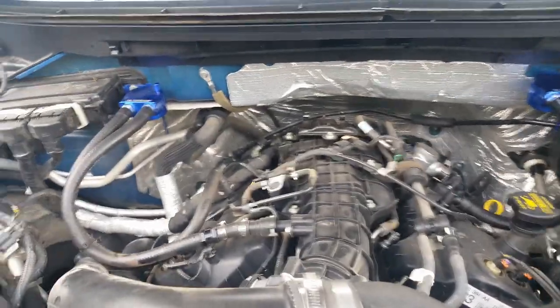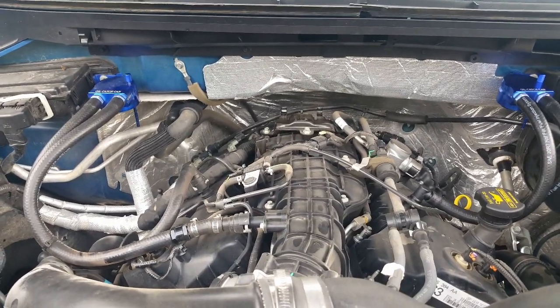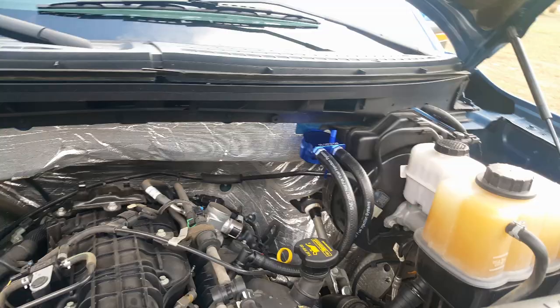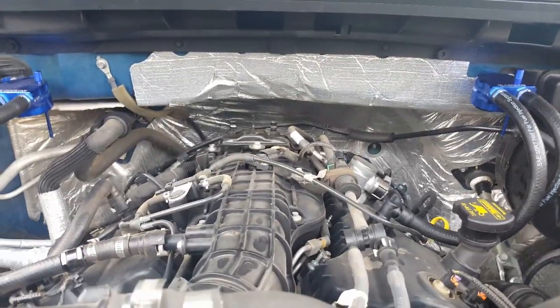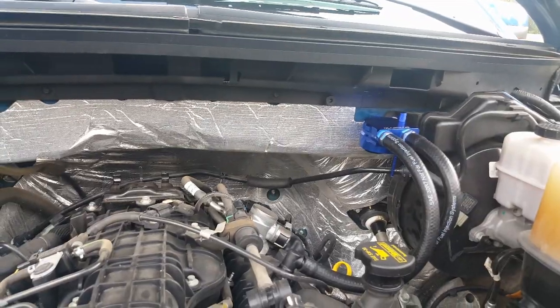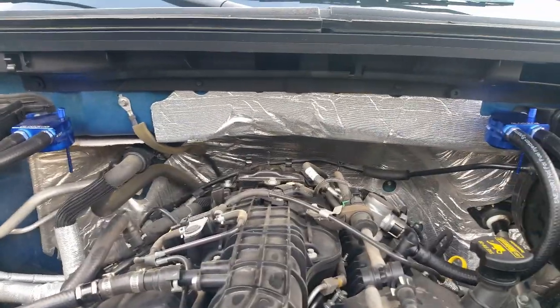There are several options out there. There's one for $400, which is astronomically ridiculous, and it requires you to modify and drill holes — I'll never drill holes in my original tubes. There are some out there for $140 per side, and that too is ridiculous. I paid $28 per can, probably $12 for hose, about $6 for the one-way valve — that's all I'm out. It's a whole lot cheaper if you do it yourself. Just make sure you get a catch can that is sealed and all you need is a two-port catch can — no three-port, no fancy gauges, no air filter that fits on top. Just a simple catch can with filters on the inside if you want.